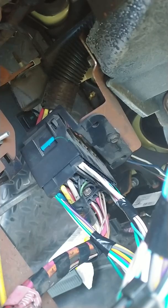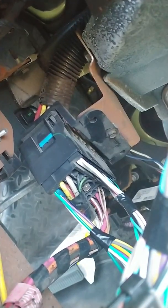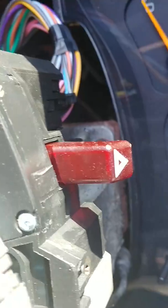Once you get the steering column apart, there's a 7-pin on that harness which is your ignition switch and your blinker multifunction switch. There's a T20 up here, torx here. There's also a little pin for the horn.